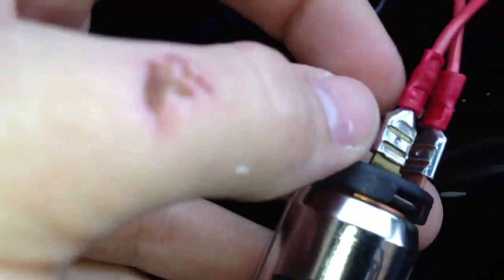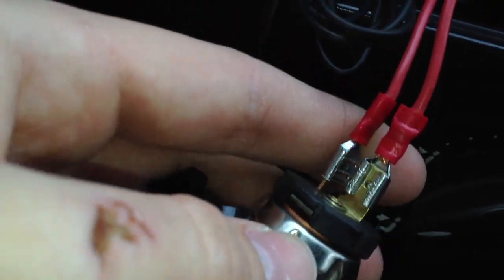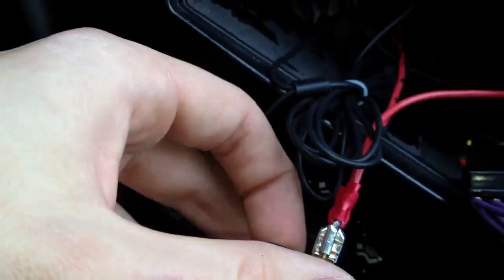And you can see that orange plug right there is the OEM Ford connector for the cigarette outlet. I just used the male plug end of this. So there are two different ones, a male and a female. That's the female that's on there right now. And the male counterpart to that, I just spliced in there. And I used the blue connectors because there are two wires coming off each one. One is for the ground up here, and one's also a positive for future expansion. I might add another power source up here. I just wanted future expansion.